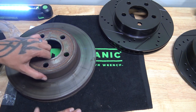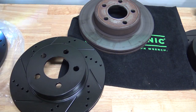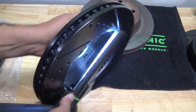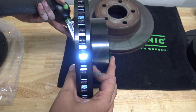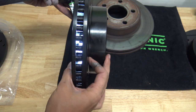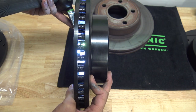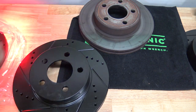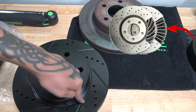When it comes to slotted or drilled rotors, people have a tendency to think that these are directional — that they have to go a certain direction just because of the slots — when the truth is they don't, unless they are an actual directional style rotor. You can see that the cooling fins or cooling vanes inside of this rotor are also straight. It may look like there are some angles in there, but it's more of an illusion because there are more supports where the holes are drilled. The cooling vanes on the inside are all going straight.